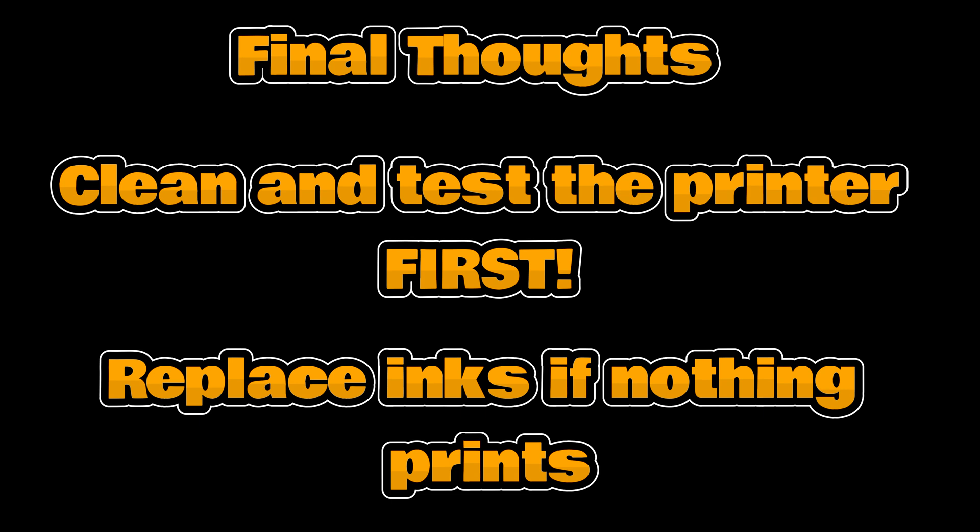But it's not always the ink. Sometimes it just needs a good clean, and as you can see from the video, you may need to clean it a few times. So don't automatically go out and buy new ink — sometimes, as the display shows, there is ink in there and it's just not getting through. It's that cleaning cycle which can sometimes kick it back to life.